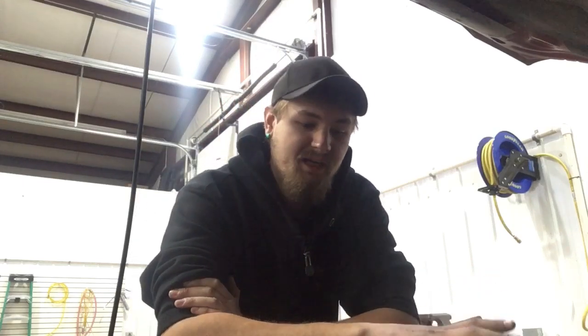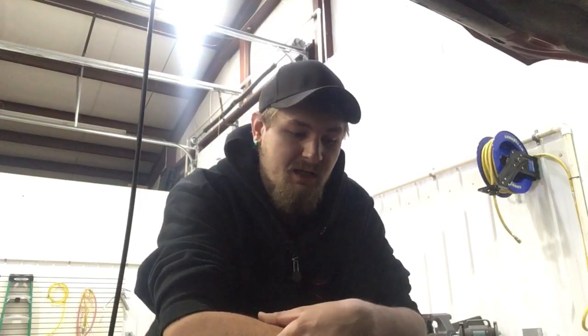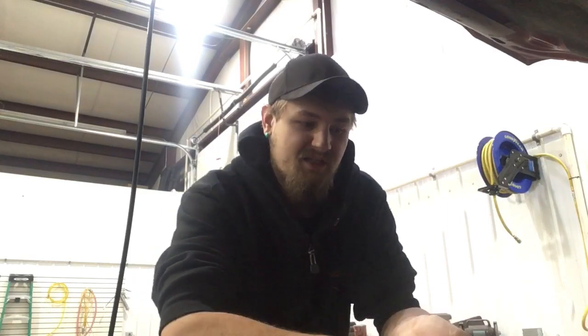In most vehicles, you're driving them enough to where it's burning off that oil and you're not too terribly worried about it. For me, this being a truck with 167,000 miles on this motor and just rebuilding it, I don't want to feed all that back into it and have it build up. On this truck, I actually deleted the EGR, and I'm installing this catch can to try and keep the intake cleaner so it'll last a little longer without any problems. We're going to be running some oil additives and some fuel additives here soon as well just to see if anything really changes.